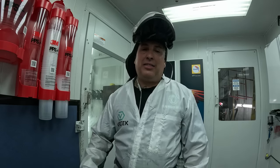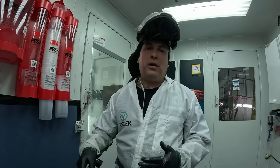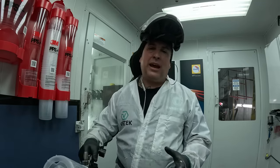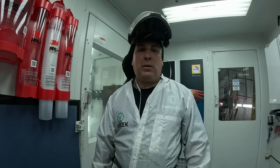So I got to think, slow down. You're not using the same product. Slow it down, put it on more like clear. Give it a nice slow control coat. It's not like the old PPG control coat. So we just got to think about that when we're basing it out.